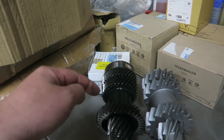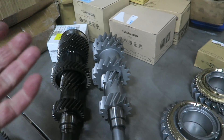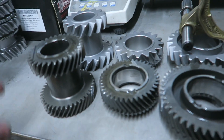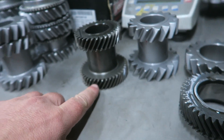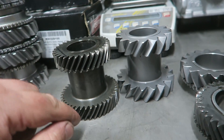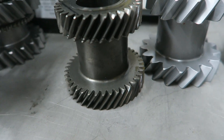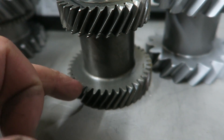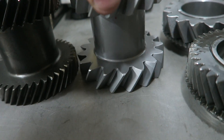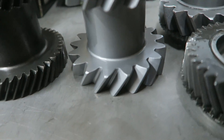This is a solid shaft all the way through versus the standard one which is a bit hollow and can bend. You'll often see people put a fourth support mod on - I've still got that on my box and it's staying on. Just to give you a comparison, look at the size of the teeth on these cogs. This is a standard set - the teeth are a lot smaller, they slip together which keeps it nice and quiet, but you have a very small cross section at the base of each tooth, making them prone to snapping when you're putting five to six hundred horsepower through them.